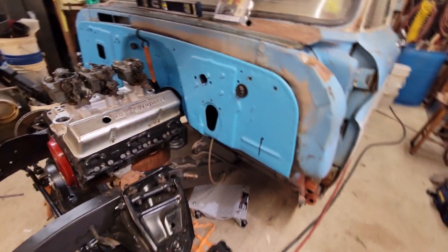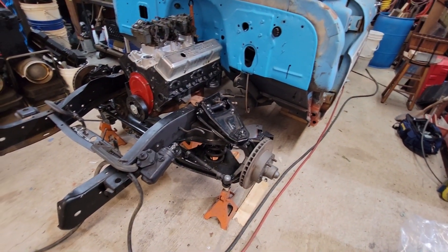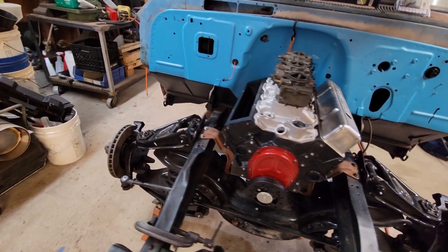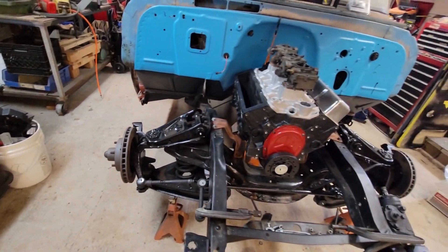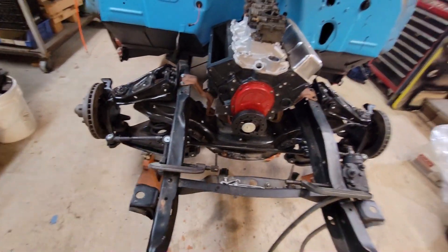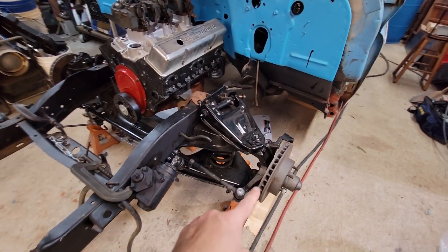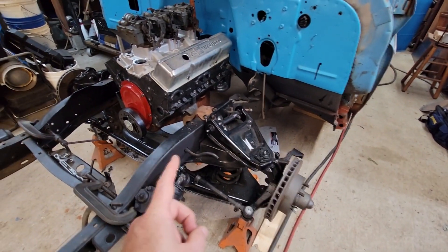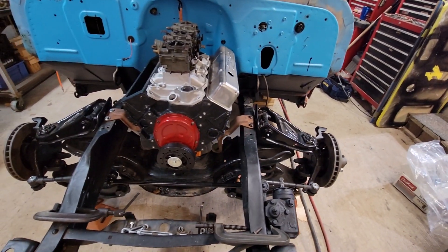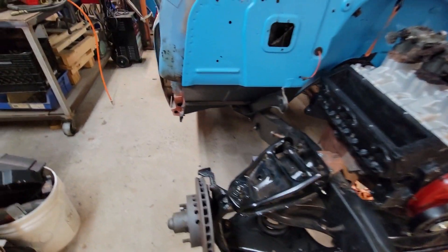I hope to get this thing going — it's probably going to be beginning to middle of summer, maybe next year. Trying to get dad's car done first before we get too much into this. On the off days I try to work on this some. What we have now — this truck should be pretty low. I'm going for a four-inch ride height, I want four inches under the front crossmember. And it being pancake, this thing should be pretty low because it's going to be a static drop. I've got two-inch drop spindles, two-inch pancake crossmember, and there's a coil cut out. We're going to see after we get my tires and stuff on where it's set, and we may go a little more.